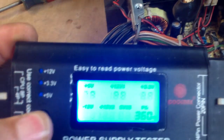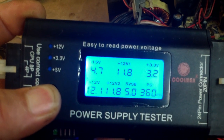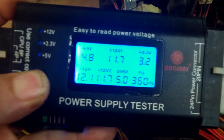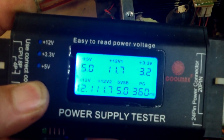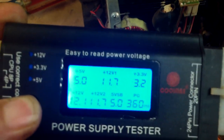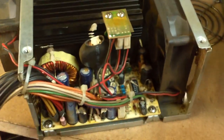Here's what we get when we run the tester — a nice steady power reading. You can see over on the left the five-volt will bounce around a little, which can sort of clue you in sometimes. But without a load test, this thing will read good. That's pretty much it — just another example of why you can't trust these power supply testers.